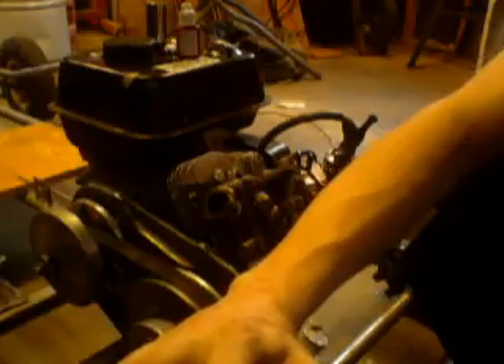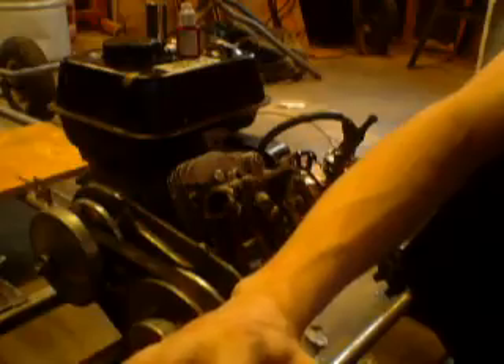Anyways, that's how you set the valve lash. Do the same on the other side — make sure you have the lash cap on the exhaust. I set mine to three thousandths. All cam exhaust lashes are three thousandths. I hope that helps.